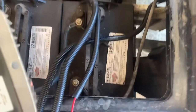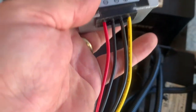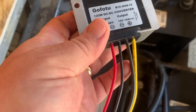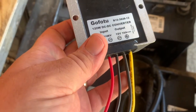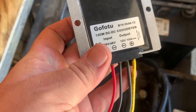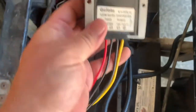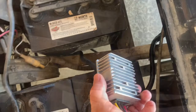This red and black are gonna go to the main negative right here and the main positive over there — I'm gonna hook one up to each side. Then this yellow and black are gonna go to ground and positive for my lights. You see right there — yellow is positive, black is ground. So I'm gonna cut these wires real quick, splice them together, and then I'm gonna mount this down on the frame in here.